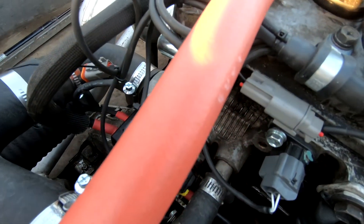While we were testing it in the workshop, we ran it up and it would idle funny and stall. With a bit more diagnosis, we found that it would misfire on the middle two cylinders. Nathan actually said that's exactly what it was doing with the old computer. More investigation — compression tests, checking.